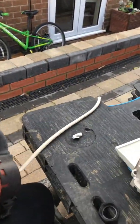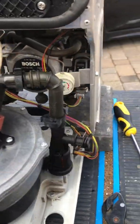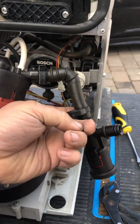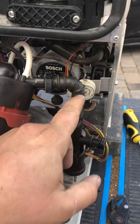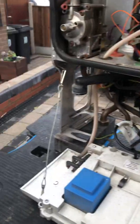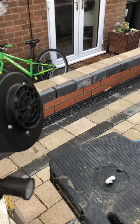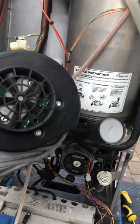Now, what you need to check on these when you take them out — and you need to be very careful when putting it back in — is this gas tube here. These are so prone to splitting here. So you can check the entire fan, check all your tubes as well, make sure everything's okay, there's nothing wrong with the unit. So that's easy to get out; it's a lot easier than it looks.